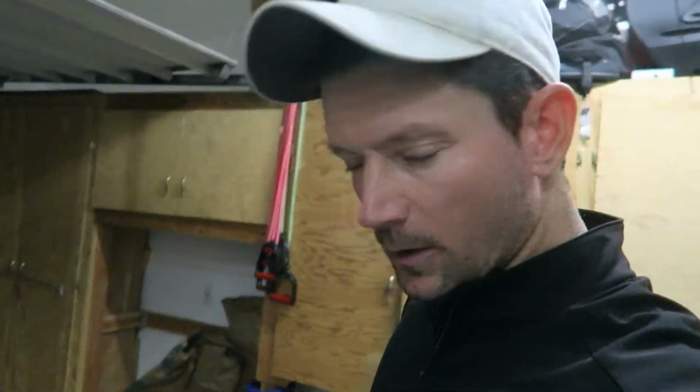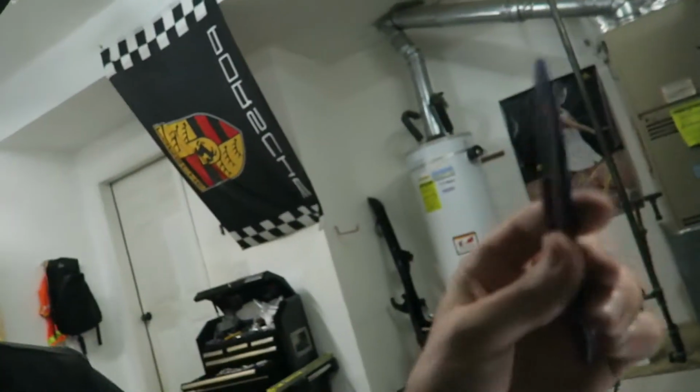So now I'm going to take off that front cap that guards the front tow hook, and then I will put on the license plate mount and show you guys how that works. You guys probably aren't gonna be able to see this, but maybe I can take my phone and put some light on it. We're going to take that piece off right there, and really all you need for that is this plastic trim tool. It's good to have these not only for your interior but for body pieces.